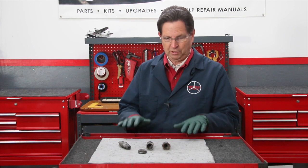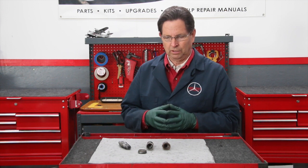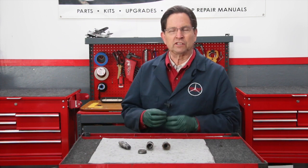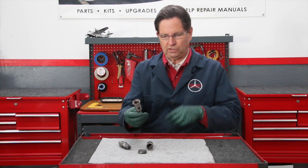In this video I want to talk about diesel engine pre-chambers and problems associated with them. Pre-chambers like I'm going to show you here were on these Mercedes diesel engines from the 50s up until the late 1990s. The pre-chamber was developed primarily to reduce sound, reduce some of the knocking sound that's associated with a diesel engine. And you're looking at two types here.